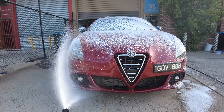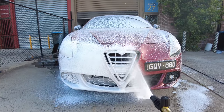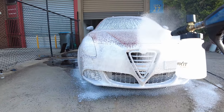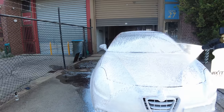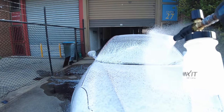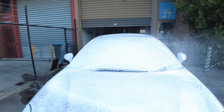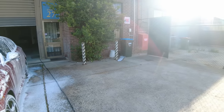In relation to stripping off existing paint protection products, I found that Lift can certainly break down and remove your more typical car waxes. And although it's probably not going to remove a higher performing car sealant, it's certainly not going to do it any favours, and it'll also start to break it down. So Lift certainly isn't going to be your weekly maintenance car wash foam or detergent, but rather the product you want to use every now and then to remove and then reapply your favourite wax or sealant.